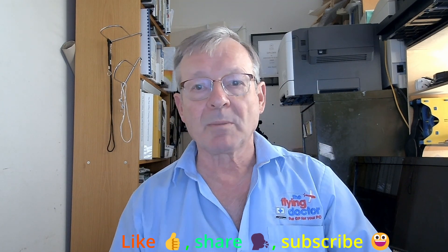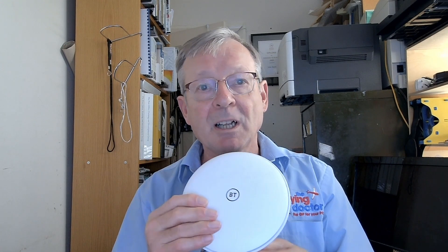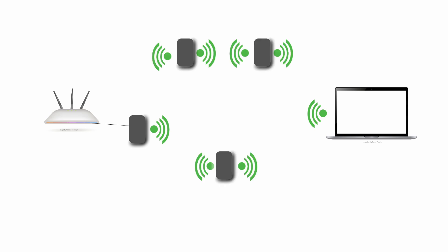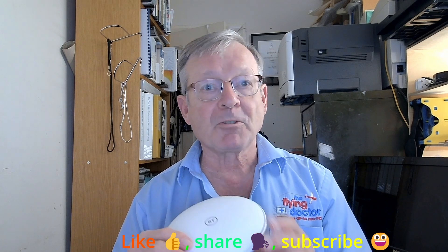Another system we can use is called Mesh. This is a BT whole home unit. I have three of these in my network. What it does is it provides its own wifi network around the house. One unit plugs into the router, and the other units pick the signal up and retransmit it via whatever they think is the best route. So it has multiple units and very good transmission signal because it works out the best route. If you've got thick walls and a big problem like that, this can be a good way of doing things. You can plug an ethernet cable into the back, so if you haven't got wifi on your computer, you can use this and the cable. The good thing is it's got much better penetration and much better transmission signal.